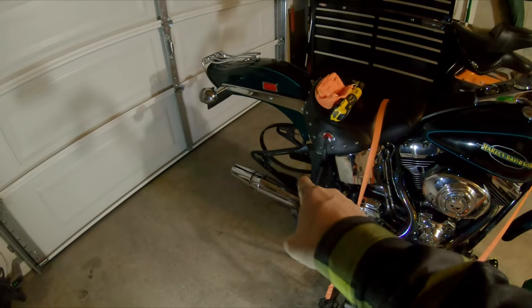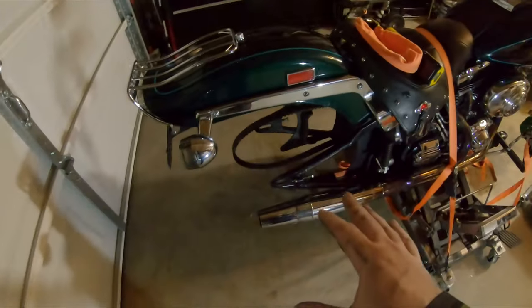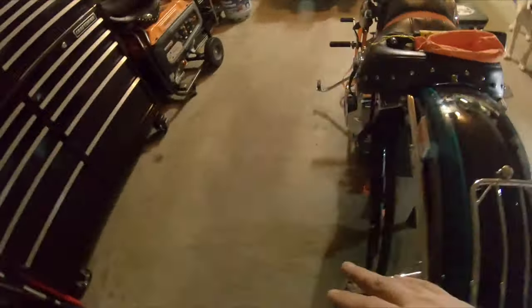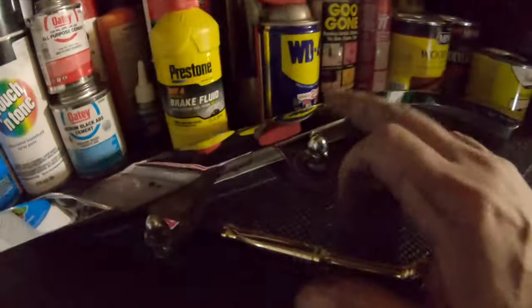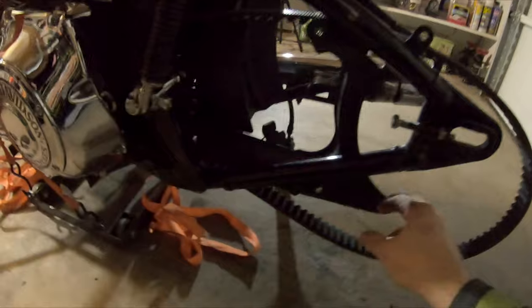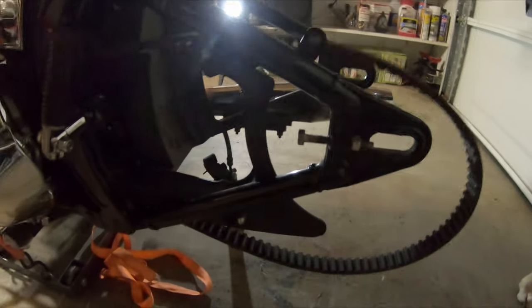That rear wheel — yeah, that's what I think. I don't know what the hell they used on that rear axle, but damn. And for those interested — I didn't know this, everybody else probably did — you've got to take that chrome belt guard off so you can slip the belt off the pulley. And honestly you should probably pull the other guard too, but I wasn't going to bother. I made it work. So that's off.